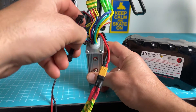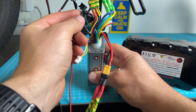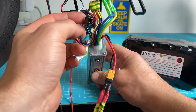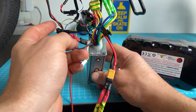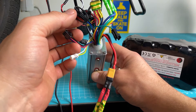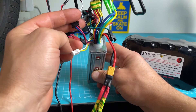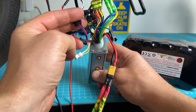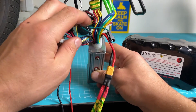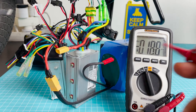What's left on the aftermarket controller: the intelligent phase wire — if you're not sure how the phase wires should be connected, connect these together and connect the phase randomly and it will auto-recognize. Blue and black is cruise control. The booster sensor — I believe that's pedal assist if you install a pedal assist sensor. White and yellow is the brake signal. None of these are currently used, so cruise control is not working.